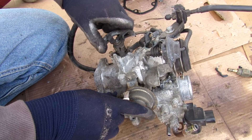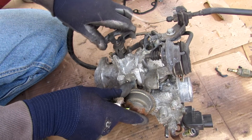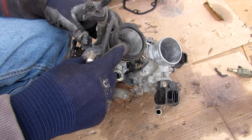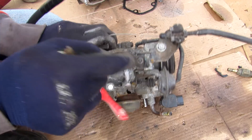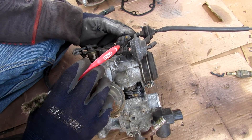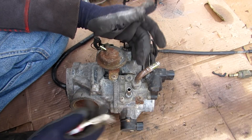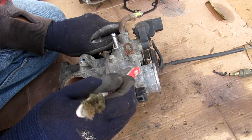This is directly linked to the pedal. There's a diaphragm that controls the stopping point of where the throttle closes — it's vacuum actuated, and following its vacuum line it goes around behind this butterfly valve. The more vacuum in the air intake, the more this moves inward, changing the idle position. On the other side of the throttle body, there's an electronically controlled idle air intake valve that allows the ECU to control its own idle.